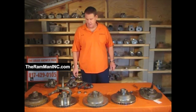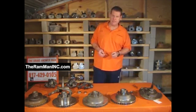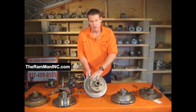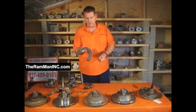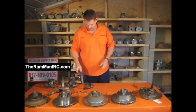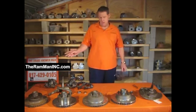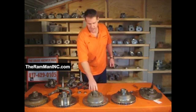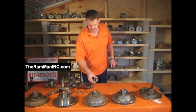Since the 80s, people have been doing a disc brake upgrade on these cars. Basically, the only way to do this was to take some 1976-and-up rotors — these 1175 rotors, often called the big rotors in the Mopar world. They also required the large-style pin caliper brackets, which are slightly larger and moved the caliper out another three-quarters of an inch. But these rotors were designed for the 73-and-up spindle, where the inside bearing is slightly larger.